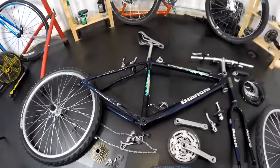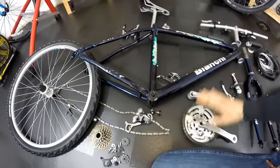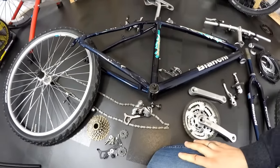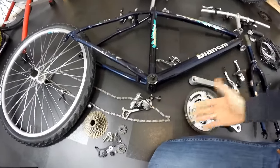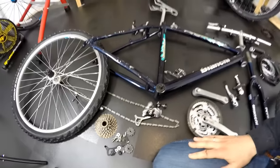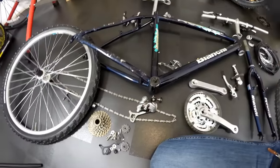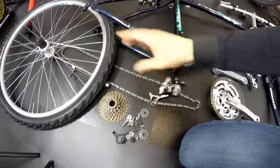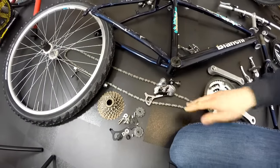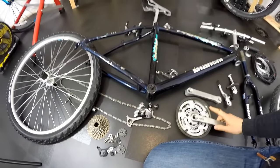When I'm buying a cheap bike, I'm not even asking the seller about the condition of the drivetrain because usually we just replace everything. But it turns out that on this bike the drivetrain is just okay. The chain extension is not more than 0.5% — it's not even 0.5% but it's close to it. So with the steel cassette it's still okay, and we don't have to change the chain. The cassette has seven gears and there are three gears on the crankset.